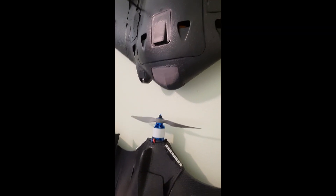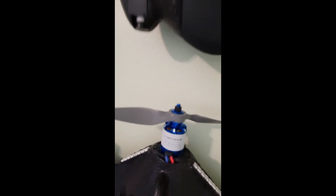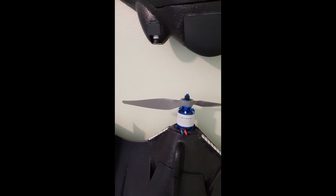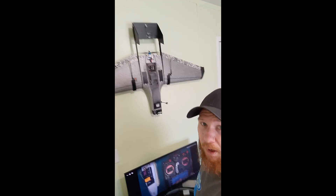So I'll come over here real quick and show you the motor installed. This is what I've been running for the longest time — I run this on more than just my AR as well. It's the Sunny Sky X2216-6, 1400kV Mark III. I've got it on there, and I've got the 1250kV versions on the Talon and the Dart. I'm even running the same motor on my NanoDRAC 40 Boomer, but with a 7x7 prop. I absolutely love these motors.